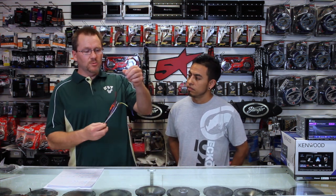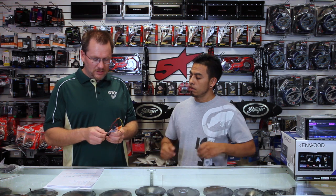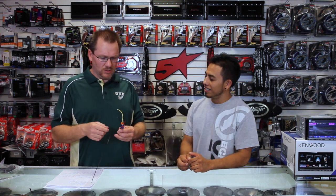Let's start with the easy one. It's got this really long black wire here. This is going to be chassis ground. This needs to go to a piece of metal, or if you're installing a radio with a nice radio interface — either a generic plug or a smart harness — this is going to go to a matching black wire. I do recommend when hooking this up in a car, check the other side and make sure there's a wire in that ground hole. There are some manufacturers — Nissan being one of them — that don't always put a ground wire in the harness. That's why this wire is a little extra long. Mitsubishi does the same thing too; they don't even bother to put a black wire.